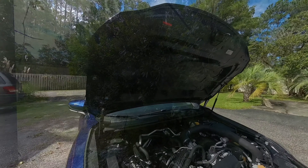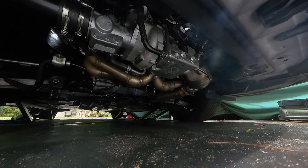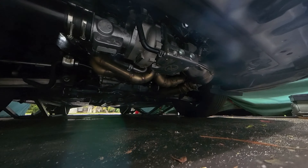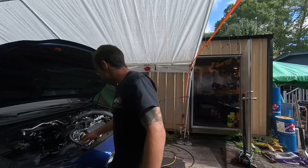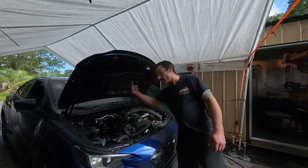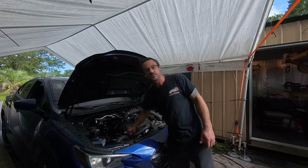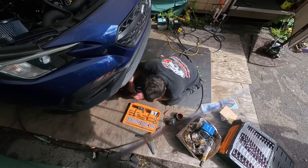I have to put the car on a lift because on Subarus the turbo is in an interesting spot — it's actually under the car. So I have to do a boost leak check from the front of the turbo. That's the most ideal place for the inlet charge pipe. Since the breathers connect up top, I don't want to blow it out through the breather section, so it's better to connect directly there — it's less likely to pop off.